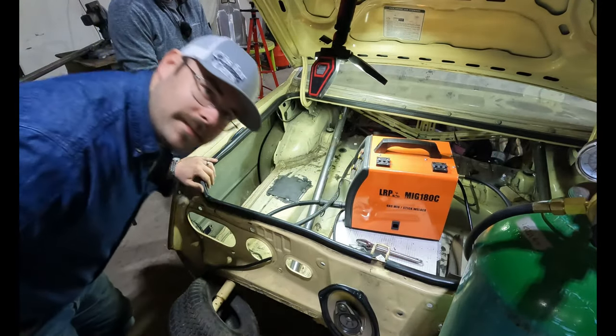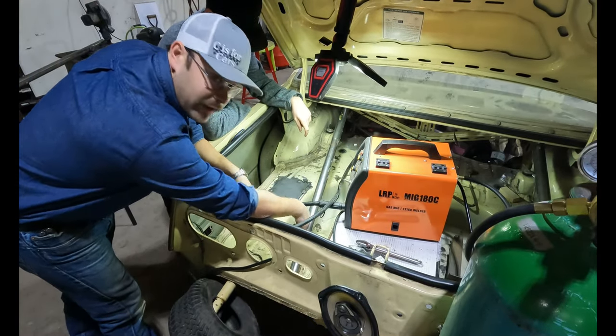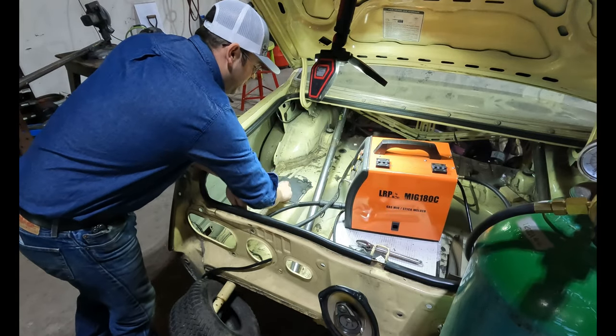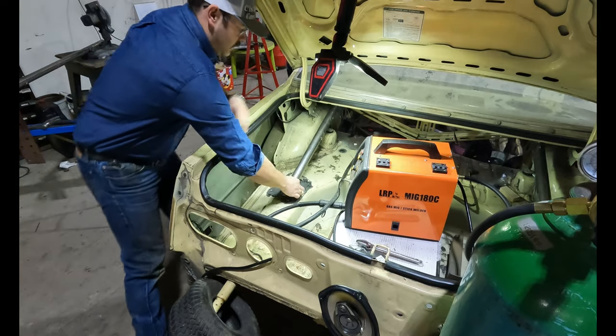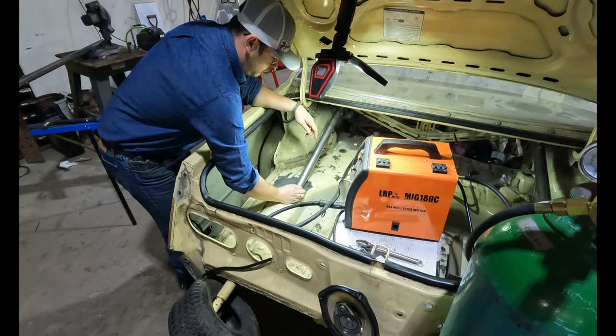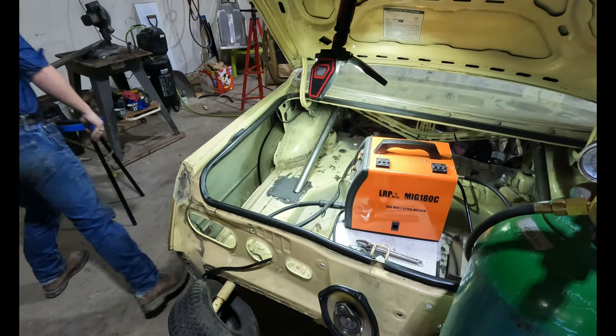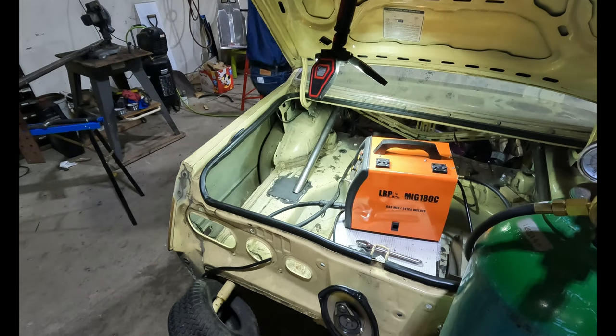Okay, so first thing we're doing is Mason's going to go inside and hold the bar on the main hoop, and I'm going to put it here. There's a chance I've got to move this forward because the bar was sitting pretty forward on that. You holding it? Holding. Now, actually, I think we should take our new Klein Tools digital angle gauge — are we sponsored? No. But let's make sure that we're six degrees. Right now we're five, so if you can push that main hoop back.